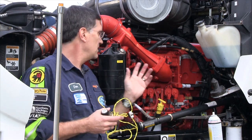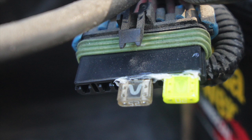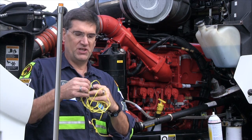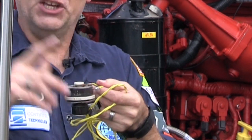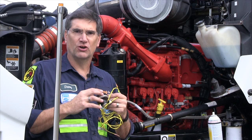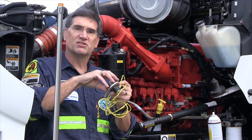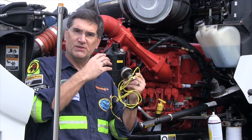What we're going to do is put a fault in the engine ECM power circuit. I'm going to go to the fuse in the battery box and install a rheostat. This rheostat goes from zero to about 250 ohms. I'll run the ECM through a switch, then flip the switch to run the ECM through the rheostat. Starting at zero ohms, the engine should run fine. Then I'll very slowly increase resistance — which by Ohm's Law makes current go down and causes a voltage drop across the resistor. I'll have a voltmeter hooked up so you can watch me increase resistance and watch the voltage over the rheostat.